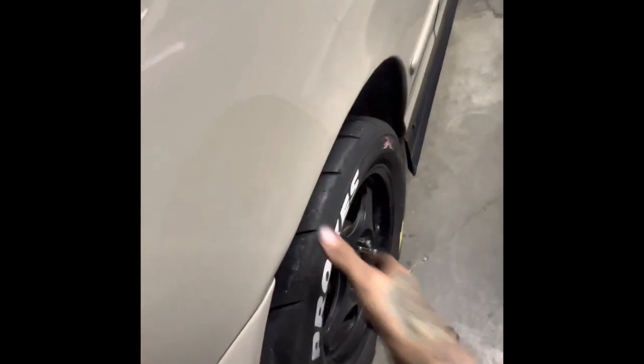So I was sitting inside, racking my brain on it some more, and I just had to know if the rears were also locked up. Now, let me let down the e-brake, because obviously if the e-brake is up, they're not gonna move. But yeah, man, even they don't have as much drag as the front, but they're still locking up. So that's all four wheels. All four corners are sticking. Feels like the car wants to stop itself. It's definitely fighting itself.